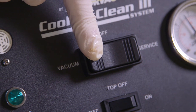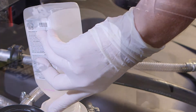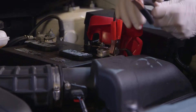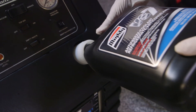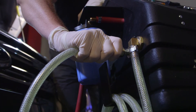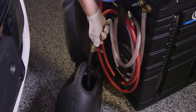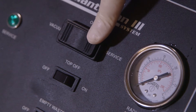Using the Coolant Clean 3 vacuum feature, remove some coolant from the radiator. Then install a bottle of the VS7 cooling system rapid flush and replace the pressure cap. Start the vehicle letting it run for 10 to 15 minutes, then turn off the engine. Connect the unit's battery cables to the vehicle battery, red to the positive terminal and black to vehicle ground. Fill the Coolant Clean 3 with the desired amount of coolant and water or pre-mixed coolant. To use the onboard waste tank, connect the clear braided waste hose to the male port on the left-hand side of the unit. To direct the waste to an external container, connect the open-end hose to the braided waste hose and direct it to the desired waste container. Close the ball valve on the flush loop and press the service side of the control switch.